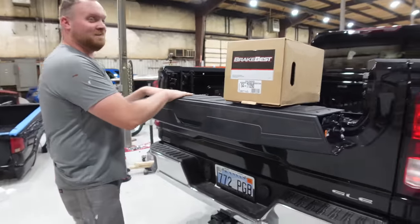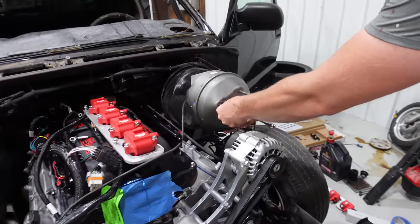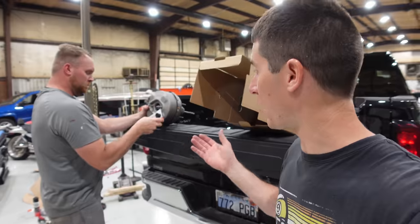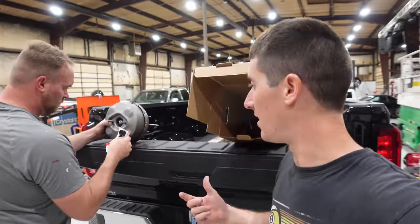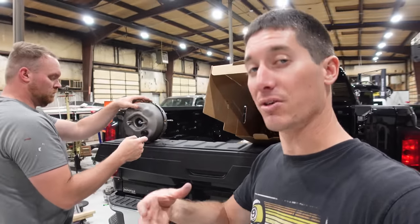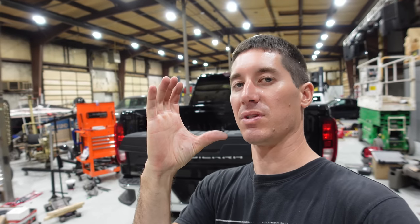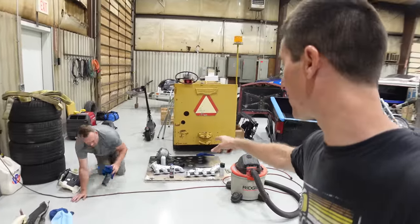You also need a workbench — you need the multi-pro tailgate. Look how much room that little thing buys you. The other option is hydroboost — a lot of guys convert to hydroboost, and people say it feels amazing on the S10. You just run another line from your power steering pump and you're good. That will save you a ton of space with just a bigger master. Or you could go to an unpowered brake system. We also did one on a Rolls that used a booster only about five inches — the bolt patterns are the same for the master and inside the truck.